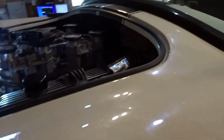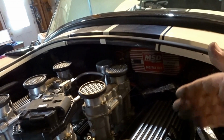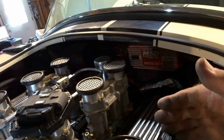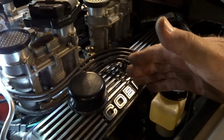I got it out far enough that I was able to get a pair of vice grip pliers on there, and then I spun it slowly enough so that the vice grip caught something, and I kept tension on it, and I got both nuts off. Then the bearing on the inside bearing flange kept getting caught on everything. First it got caught on the brake pedal, and then I figured out that by depressing the brake pedal, I could wiggle it around that, and so I did. That was the next hurdle. Then I got the bearing all the way to the firewall, right about there, and there was no way to get it past there. I just couldn't get an angle on it.